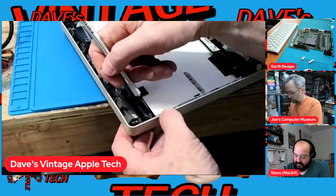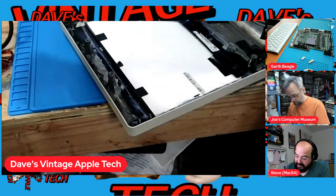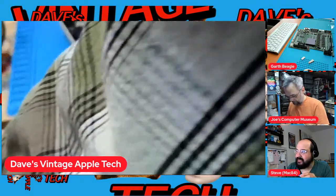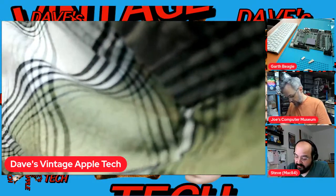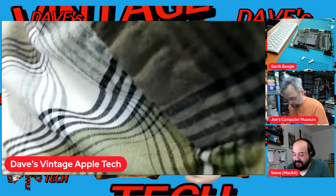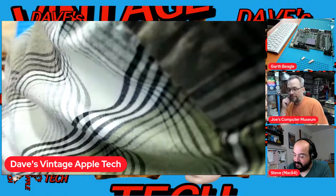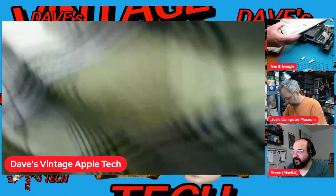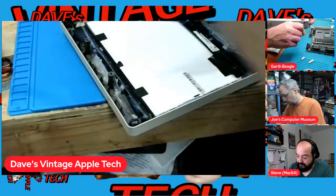Okay. Just looking at this little guy. Ground. SW clock, I guess. Is that what you mean? Yep. Okay. And then data would be SWDIO. Okay. Because I'm an idiot and I don't know these things. And then power is which voltage? 3.3 volts. Okay, so it looks like there are 2 pins of 3.3, so I guess it could be either one. Yeah, but they should all be on the bottom row.